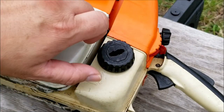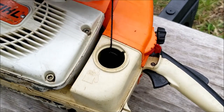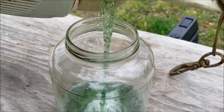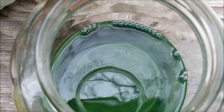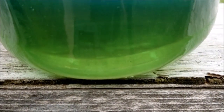I think I heard some fuel sloshing around the fuel tank. They may have tried to start it and when it didn't start they put it into the garage sale. I want to pour it out and inspect its condition — it still might be usable, or if it was stale or had water in it that would explain why it didn't start. The fuel is still fresh and there's no water in it, so I'm comfortable pouring it back into the tank.